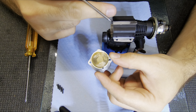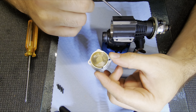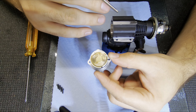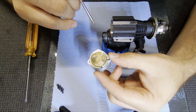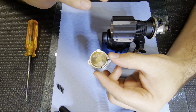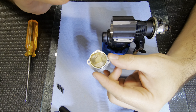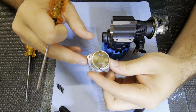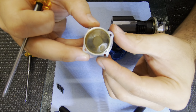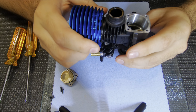It's got a really nice lubrication package, so normally you don't have to worry about running any after run. This engine has actually been sitting for about two or three weeks. It was a brand new engine — ran it in, broke it in, ran it for an entire gallon and a half, about five liters, then I put another engine in. This engine has only seen a full jug worth of fuel — exactly a little over a gallon, or five liters — and that's the 30% nitro as well. The backplate's got a nice coating with really good lubrication.